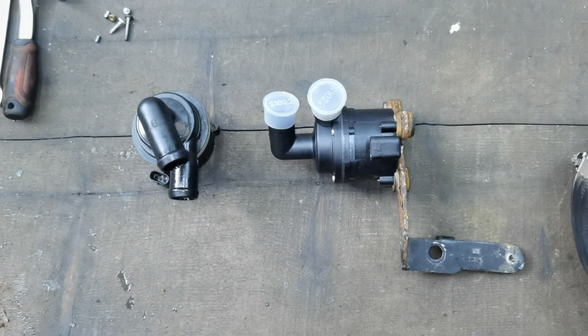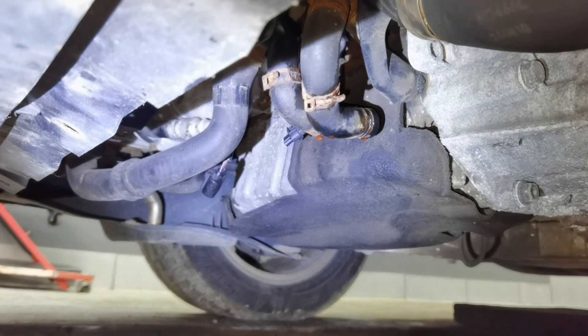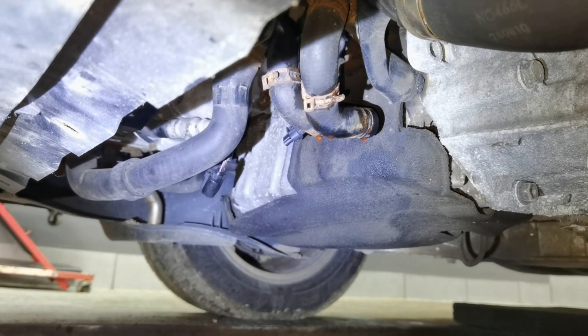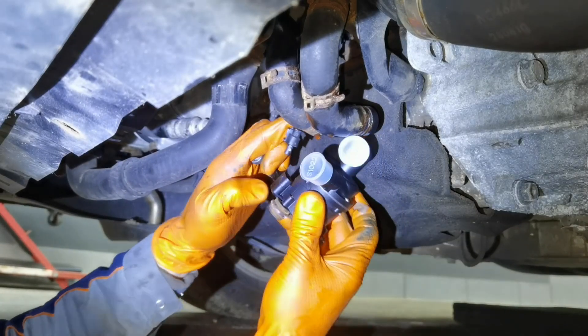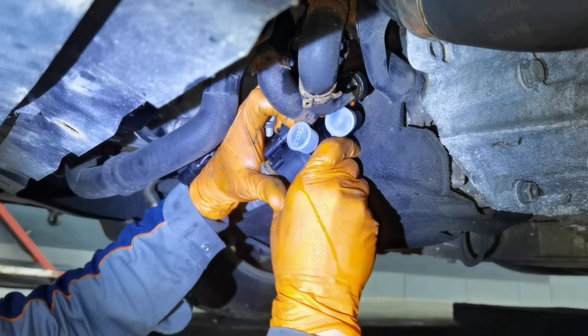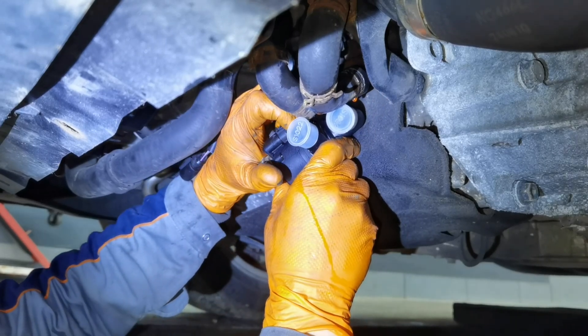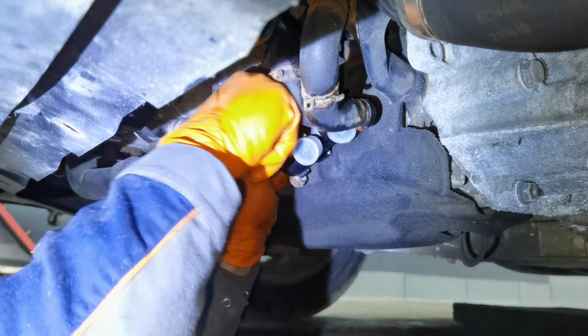After you finish this job and connect everything back to the vehicle, you have to put brand new coolant into the system and let the car idle — or drive the car — until the thermostat opens and the coolant passes through the radiators and engine. After you see the coolant level drop a little you'll have to add more coolant to the maximum level and the job is done. On these vehicles you don't have to do any bleeding because most of them will bleed by themselves while you are driving. Now I'll attach the power supply to the auxiliary water pump, secure it back to the engine, and then connect the hoses.